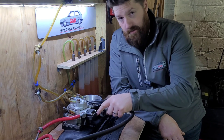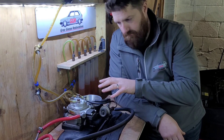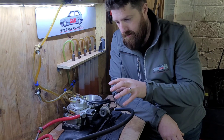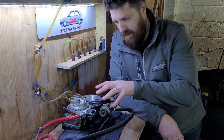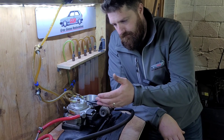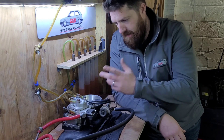The most important thing: make sure the EHA is unplugged when you're doing any tests. All electrical components on this — including the potentiometer — make sure this is unplugged when it's on your car before you test and adjust anything. You want the base settings with no electrical influence. Get everything set perfectly, then when you plug it in, that's when the car does its job.